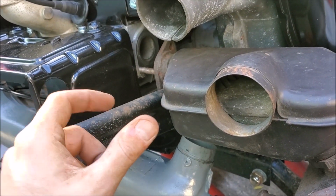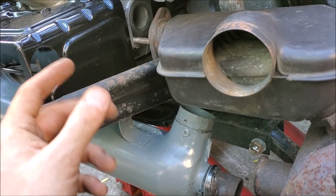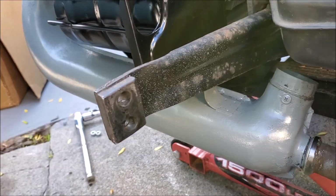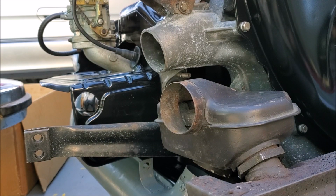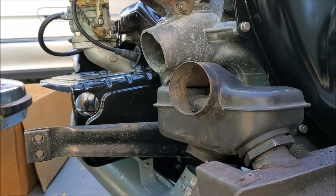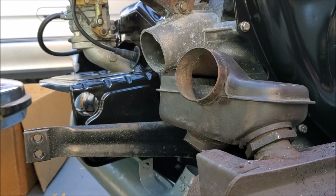There's a little bit of wiggle room here because connecting those two pieces, there's a little silicone hose that you have to make up about an inch of space, so there's definitely room to move around. So I can still do that when the engine's out, or the engine's in. So I'll loosen up the other side heat exchanger. Okay, take two. See if this will work. I guess what I need to do is just get it over the exhaust studs, and it should be good to go. This guy. Goes one heat exchanger.